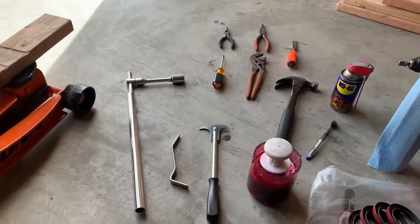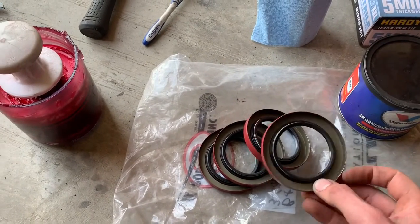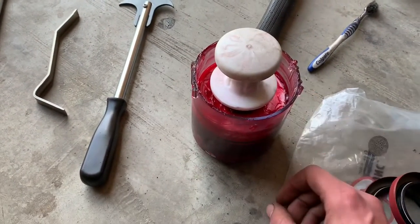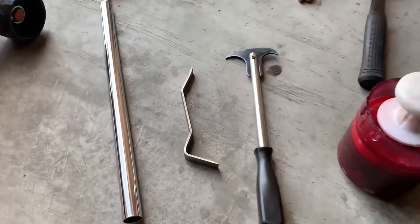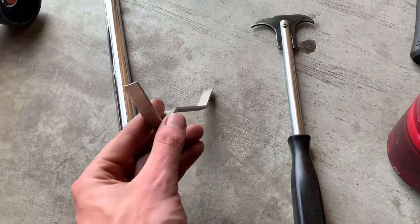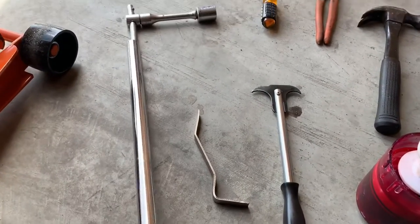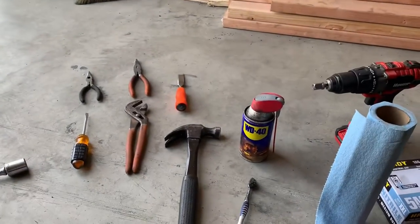And cleaning it all up. So right here are new seals - when you take out the bearings you're gonna need new seals, so I got four of those. I got a can of grease. And then right here is one of the specialty tools - this is a bearing packer. It is super handy, I'll show you guys later how it works. It saves you a lot of time, it makes greasing your bearings really easy. This is a seal puller, to get the old seal out. This right here is a brake spoon - it makes it really easy to adjust the brakes. You don't even have to take the tire off or anything. You just jack it up and you can adjust it. I'll show you guys that later too. I'll put a breaker bar on here just in case the lug nuts are a little tight to get off, and I always got some WD-40 for that too.